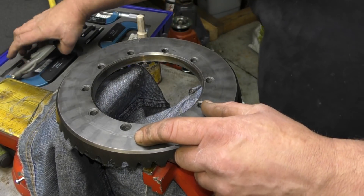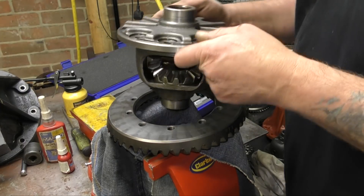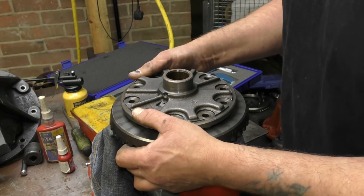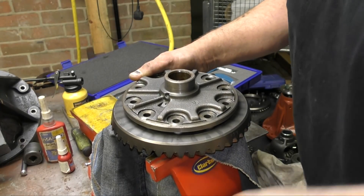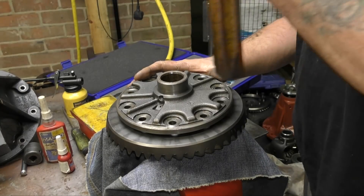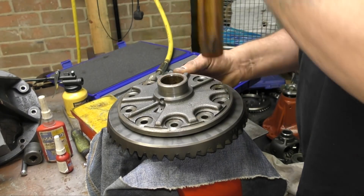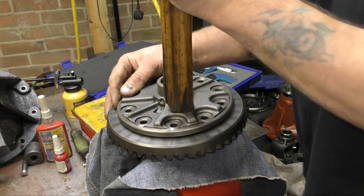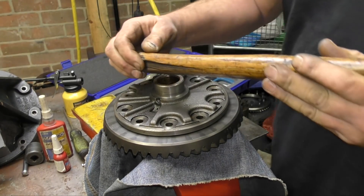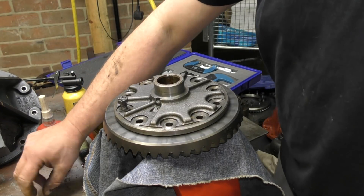I'm cleaning the bolt holes — you also clean the bolts so they're dry. I don't have a soft hammer, so I'm going to be using the softest part of the hammer to tap this into place. This is a second-hand, better diff housing which I'm going to be using with this diff. You could as well be putting a limited slip diff in — it doesn't matter. Never hit metal with metal when you're trying to force it through like this. It is a very tight fit, so you want the bolt holes to line up. You can see the gap between the housing and the crown wheel — you do not want that there afterwards. My hammer handle is now splitting — I should have had a soft hammer.